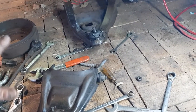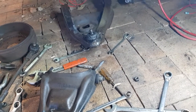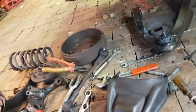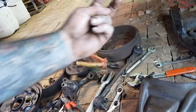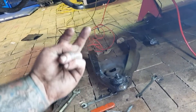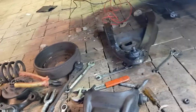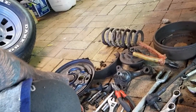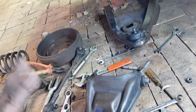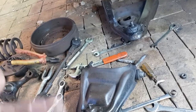All right. So, we've got it all torn down. There's the two bolts in there to hold the lower in. I think it's pretty self-explanatory. There's two 12 mil, half-inch bolts underneath that hold the shock. There's two 7/16 bolts in the back that hold the wheel cylinder. Yeah, so it's all pretty self-explanatory, and you would have sort of seen the whole process.